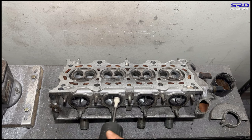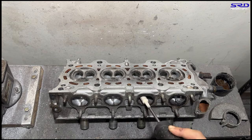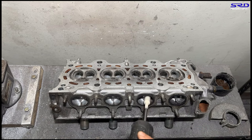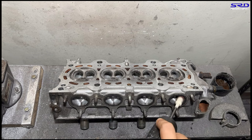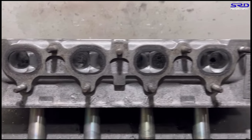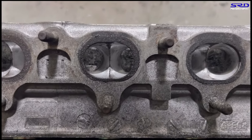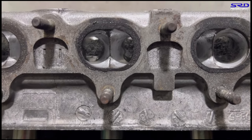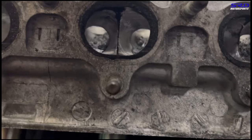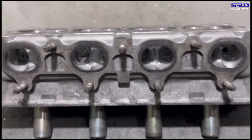We're trying to get the transition from the valve guide area outward to be really streamlined and efficient. You have to understand it has to flow well on the low cam and also flow well enough on the high cam. You can see it's almost there — not quite yet, but almost. Now let's blow it out to show you guys. Be careful — don't inhale the aluminum dust particles.